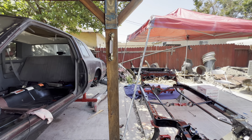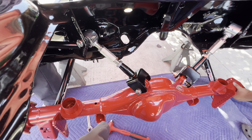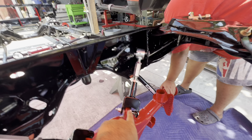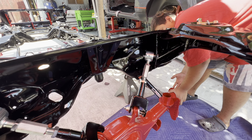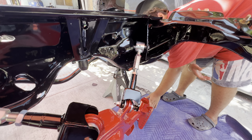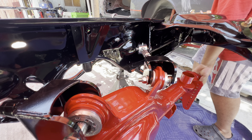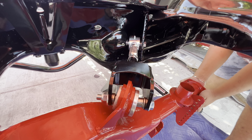We're still missing the inner seals for that — it's already clean and everything. So we bring it in, differential is installed. You can torque these down without having to put the car weight on it because they're roto joints. I'm gonna try to show you on camera the flexibility — you see how it's flexing this way? And that one, how it's flexing? If you have regular rubber joints, the diff won't flex that fully down. Pick up your corner so you can see that flex — see that? Those double joints, see that? Beautiful — see the flex on it.